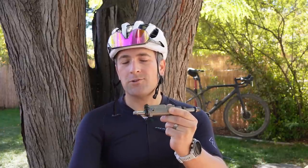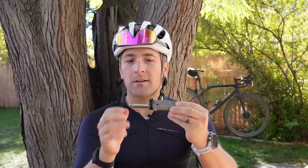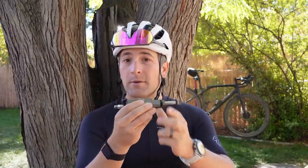In the open position on the left, you're gonna have less compression damping, and the frame post will be allowed to move backwards a lot easier. As you flip it to the middle or even the closed setting, the damping is a lot more firm, and it takes a lot more effort to move the shaft on the damper.